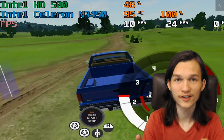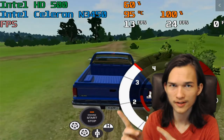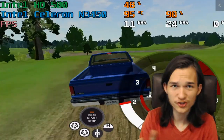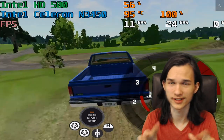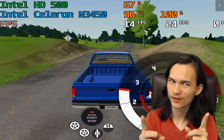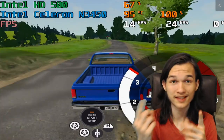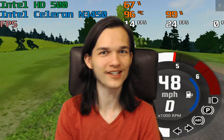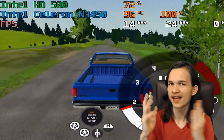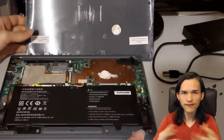At least the manufacturer did something pretty good, because they limited the computer to using 6 watts, which brought the temperatures down to around 90 Celsius. Though, they forgot to lock it — or maybe they didn't mean to. So now, people like me can go in there and adjust some stuff. If I set the computer to use as many watts at once, that's when it starts getting toasty.